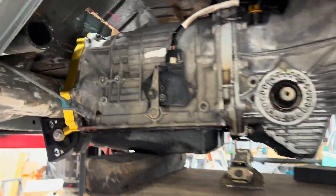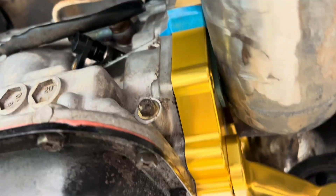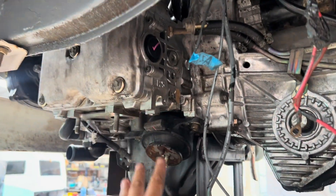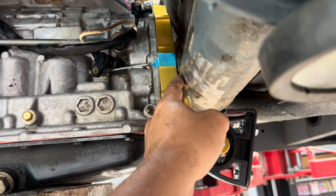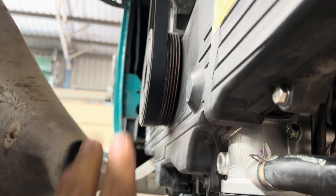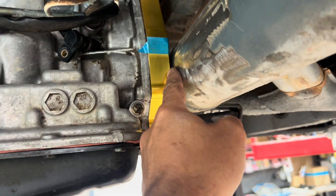Okay so we've got our engine and transmission in. Here's the hole that we've cut for the clearance. We've got three millimeter packers masking-taped to the end plate - one on this side and one on this side. This allows us to butt the end plate hard up against the torsion housing knowing that we'll always keep a three millimeter gap. We leave these packers in while setting the engine mount cradle so we know we're never going to creep forward. You don't want to make this gap too big because a bigger gap means the engine won't fit in. It's important that this three millimeter gap is kept.